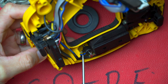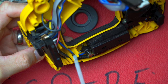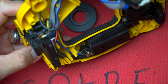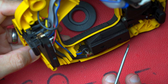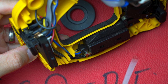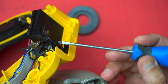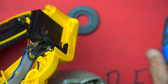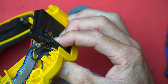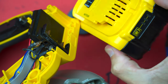I've also got a nice fat diode on the bottom of the switch. This is to control or stop the back EMF — when you let the switch go and before the motor stops you get a reverse current flow, and this diode reduces or stops that voltage. I think it limits it to around about one volt, protecting the rest of the circuit. Between the battery contacts, the holder and the casing, there's a little buffering spring — if you hit the battery in there's a bit of spring in the system, probably just to protect the contacts and possibly the battery itself.